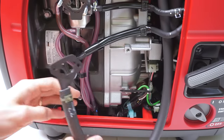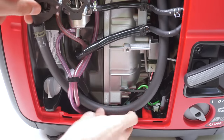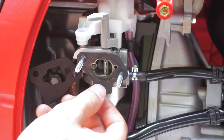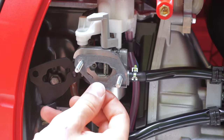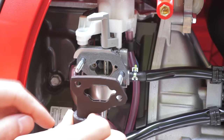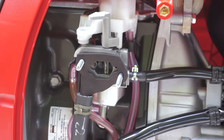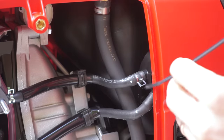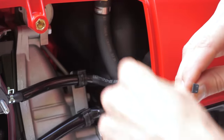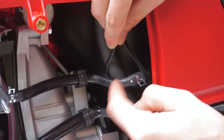Make sure the propane line is run behind these pink hoses for a better fit. At the carburetor, pull off the old gasket, dispose of it, and replace it with one of the new gaskets provided in the kit, then slip on the propane fitting. Place another new gasket in front of that. On the other side of the propane line, take the zip tie and tie the gasoline line together with the propane line, making sure the zip tie stays on the right side of the hose clamp to avoid pinching the gasoline line.